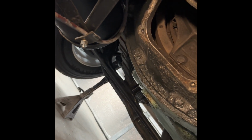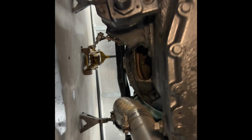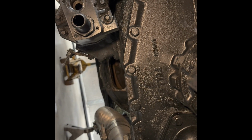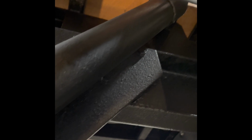I also greased the entire chassis because I realized I had never done that on this truck. Shame on me. Not that I've put more than probably 100 miles on it, but regardless, it had never been done, so we got grease all over. I mean, I'd done the drive line, but not the rest of the chassis. And surprisingly, kingpins, all the spring bushings, and all the dump hardware all took grease. So good news. I also removed all the old hoses going to these cylinders here.